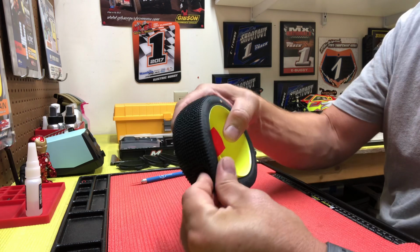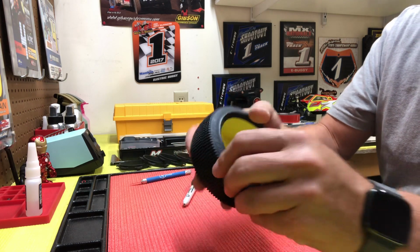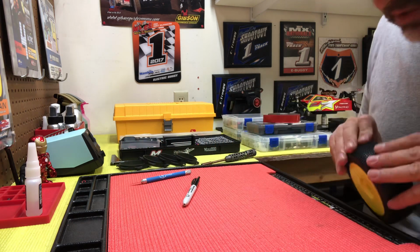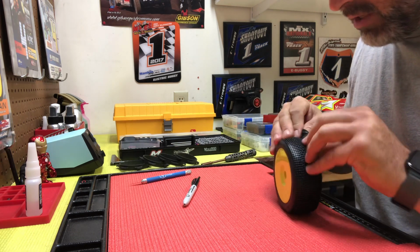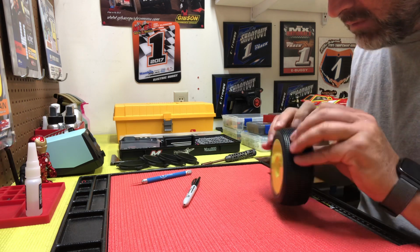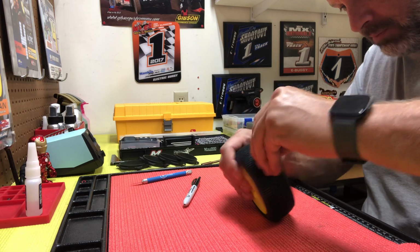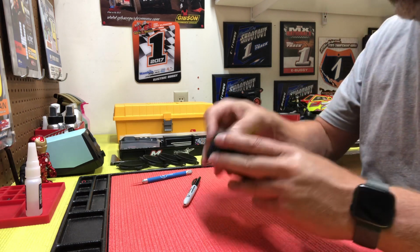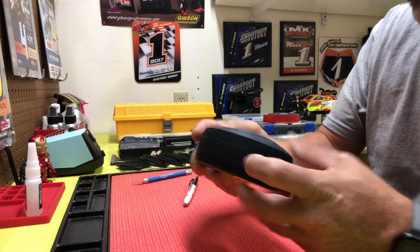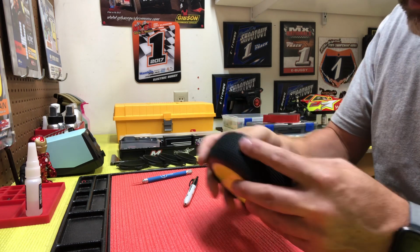Okay, now I'm going to take this and I'm going to pop it out all the way around. So I'm just pulling out that backside bead. And I'm going to peek in here, and you guys can see, to make sure that it's even. So I'm just going to basically look down on it, and if you're looking straight down, you usually have about 2 mil or so, and just make sure it looks the same all the way around. And I'm just peeking in there. So where the tape is actually at, I'm going to give it a little bit of pull towards me, and now we're good. So now you can see this is all hanging out from me peeking on it. Now I'm just going to put it back in, just like we had it before we wanted to take a look at it. And I'm going to work it around with my thumbs and work it evenly, just like you're getting ready to mount the tire.